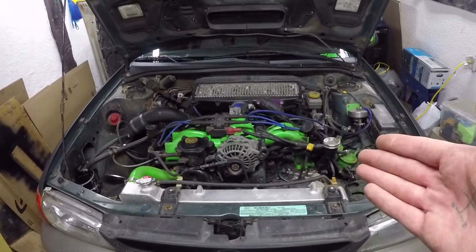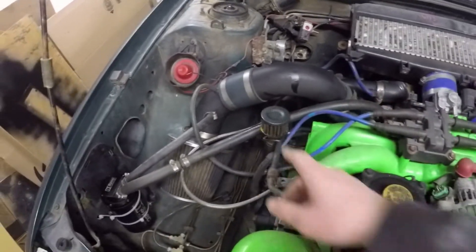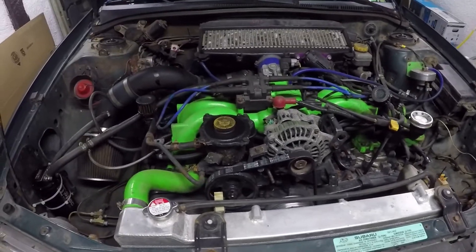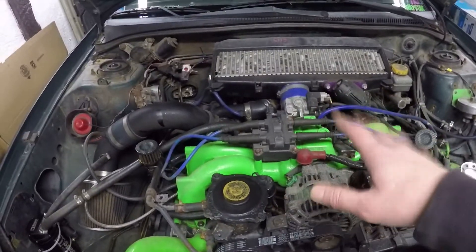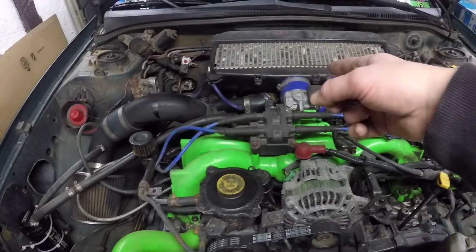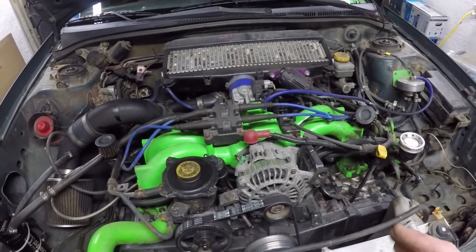Now that I'm pretty much warmed up to operating temperature, I'm going to shut it down and let it cool just a little bit, then pull some plugs out. Here it is in all its glory — there is oil staining just about everywhere. The breathers have been puffing a little bit of oil, which makes me think there is some blow-by, but because it performs so well I'm not too concerned. I think I'm going to redesign my catch can and the ventilation to the engine. To do the compression test I'll remove the air intake, the intercooler, the plugs, and disconnect the wires.